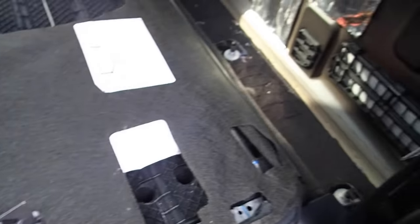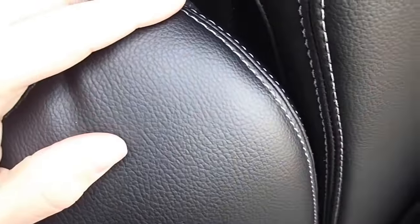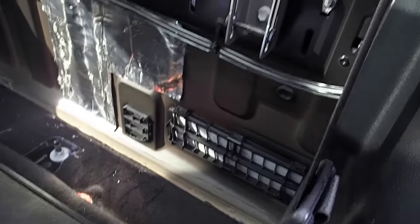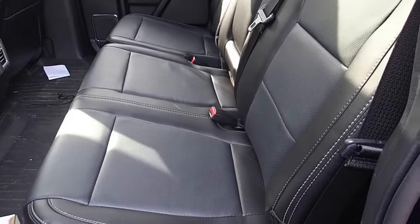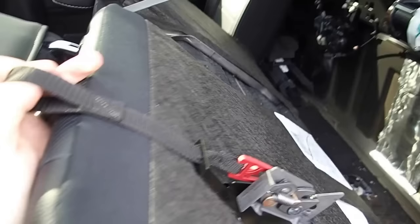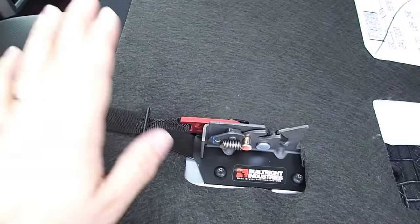We're fully installed, and we're going to lift this back up. Remember, we need to hit that crossbar in the latch, so I'm lifting around the bottom and lifting the seat back up, then giving it a firm shut. I can drop the seat back down right away, and we should be good to go. Unlatch it — we're down, the bar is back where it should be. And that's your installation. Thank you very much. If you have any questions or concerns, don't hesitate to send us an email, get in contact with us via our website or social media. Thanks for watching.